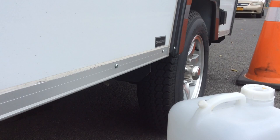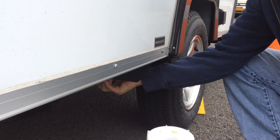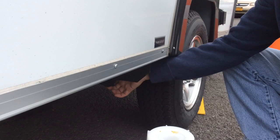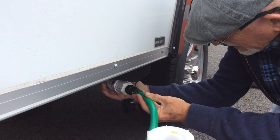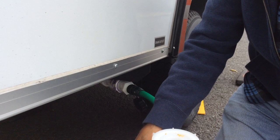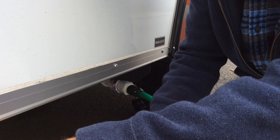I meant to do this at the trailer park but it just never happened, so we're doing it here on the road — my house is like doing it on a major highway, they come through here like crazy. First you take the cap off; I think there's a little bit of water in here because I've already anti-freezed the trailer. Then you take your little gasket, put it in there. I've got a little cap here — the air vent — take out the air vent; these all go back in the box until I'm ready. You just take your little hose here. You don't want to bend it — it's a little brittle because it's cold. And you hook up your hose.